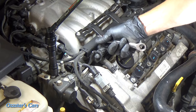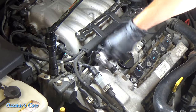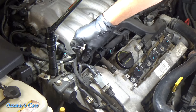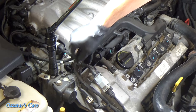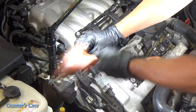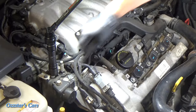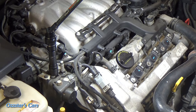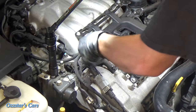There's an engine hook bracket right here — it's kind of bending up and over this way. I'm going to loosen it and get it out of our way so we don't have to deal with it. I've got a 14 millimeter ratchet wrench — give this a little tap, loosen that up, and get it out of our way to make it easy on ourselves.